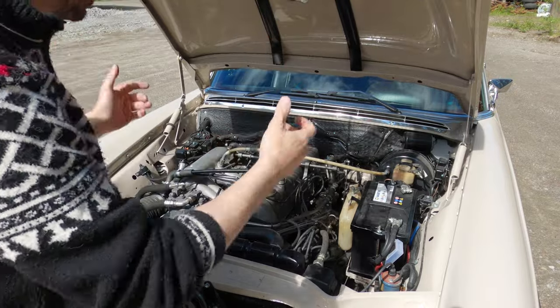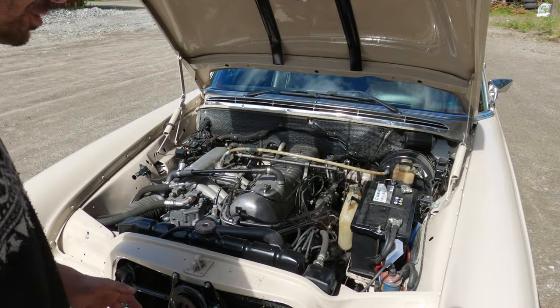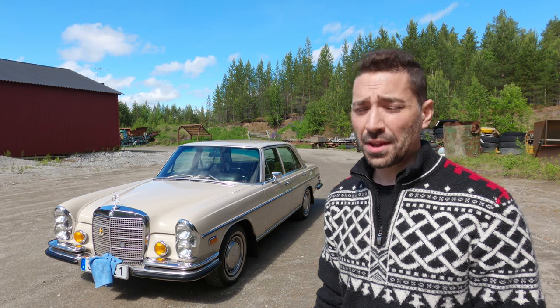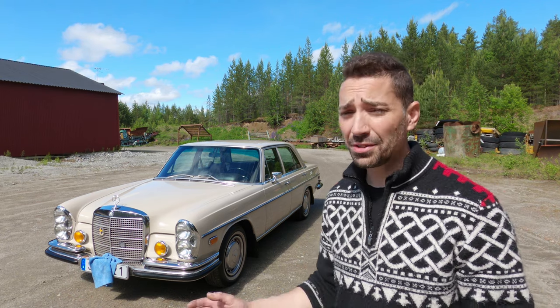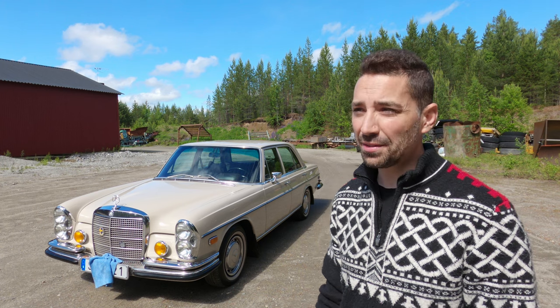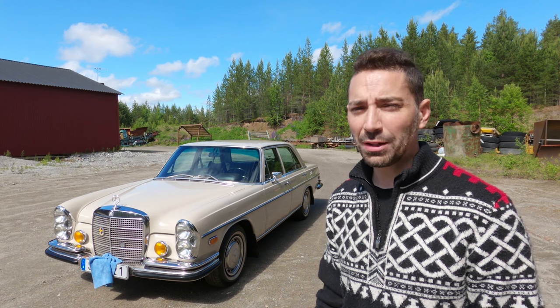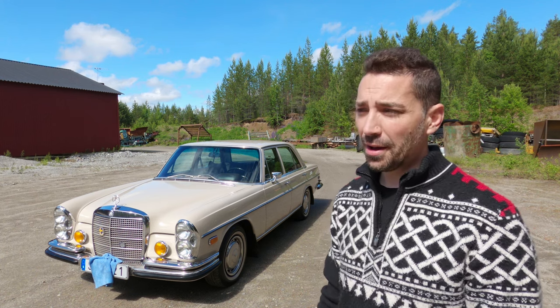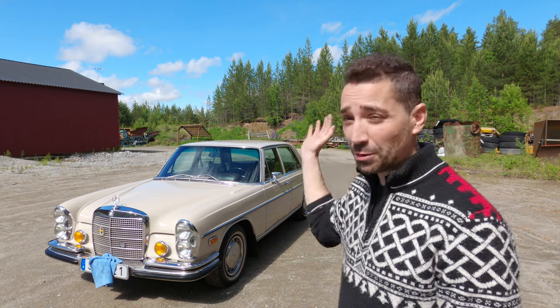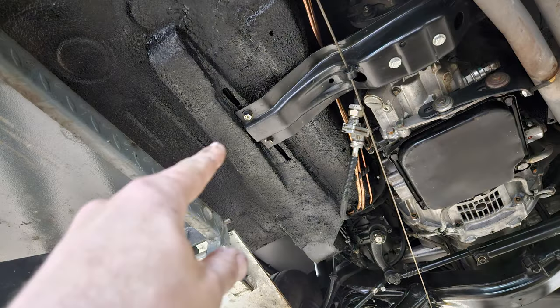As well as the interior, the engine came out, everything came out — the transmission, the axles — all sorts of work has been done. Other things like the entire subframe at the front was removed, shot blasted and painted. Everything's been done, there's been no stone unturned on it. And obviously the fabricator, the welder, had a massive job because it had some serious corrosion underneath. So once I'd finished taking it all apart and shot blasting it and handed it over to him, he essentially had to build certain parts of the underneath from scratch again.